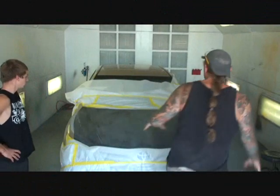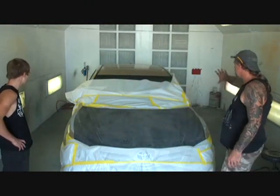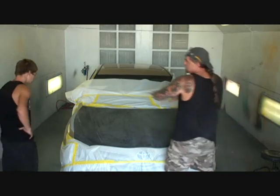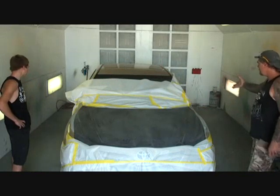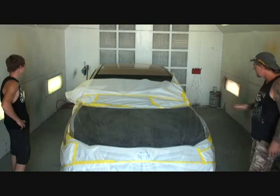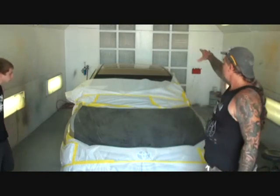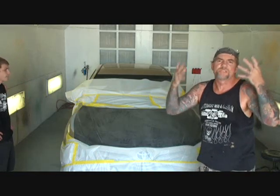We're going to paint the whole front end of this car and also the side — the two doors. We had to replace the hood; there was some minor damage on top of each fender. We'll paint and blend the paint in, then clear it. There's also damage on the driver's door side, so we'll blend the paint into the fender and rear door, then clear coat the whole area. We don't want to get overspray on the rest of the car, so we have to cover it.